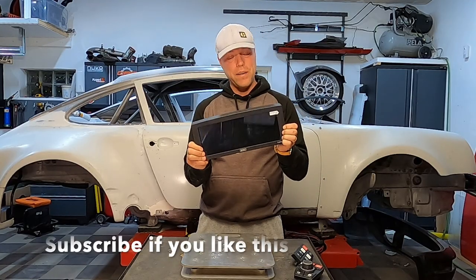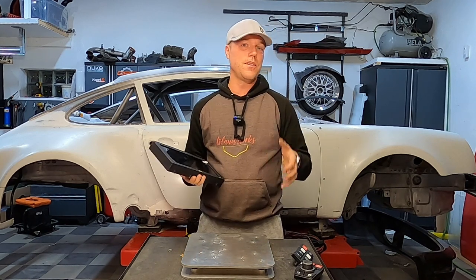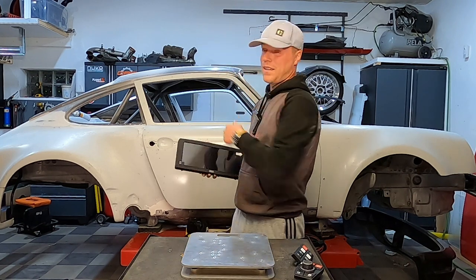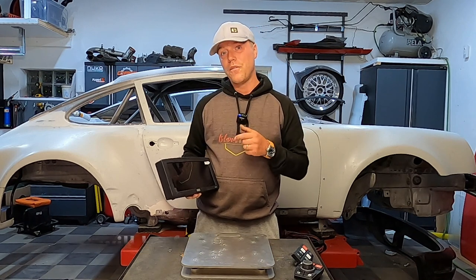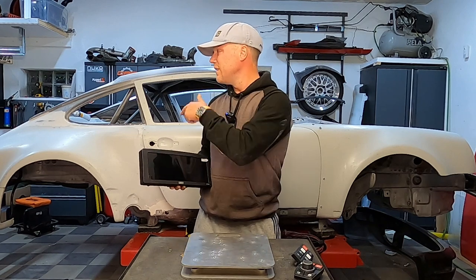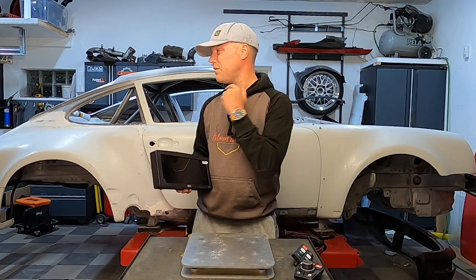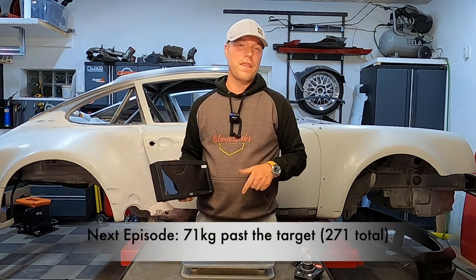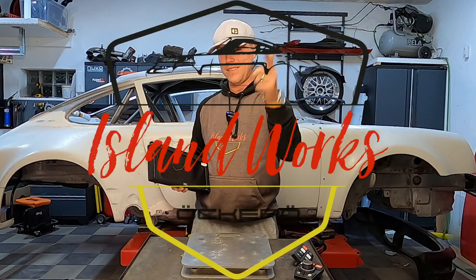That is the end for today. We really figured out how these things communicate — I hope you understand the concept of CAN bus and how you can do some really cool stuff with that. We saved three kilos, meaning we're up at 270 kilos total. We figured out that we need to cut the entire dash out of the car as well, so that's going to be another fun endeavor for another time. One thing I figured out: the MoTeC M150 is overkill for this application — I could have gotten away with the M130. The PDM-30, however, you need one of those; you will not get away with the PDM-15 on one of these cars. So with that, 270 kilos down the road. Subscribe if you like what I'm doing — see you next time.